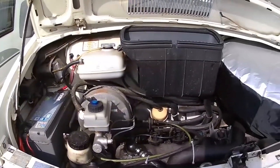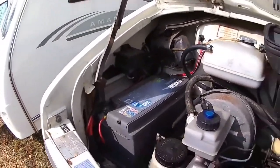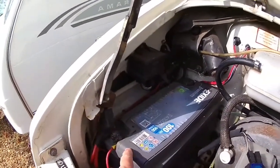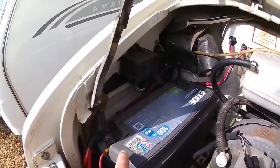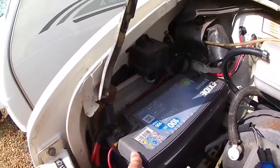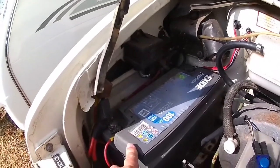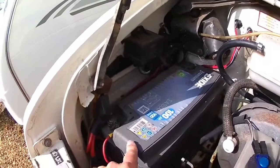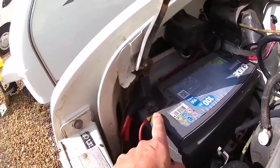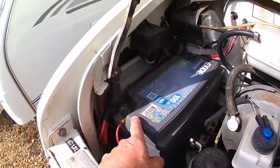The third thing you've got to do if you're going to change the starter motor is disconnect the battery. But before you do that, on modern vans with solar panels you have to check that the battery-to-battery charger is disconnected, because on some modern vans the solar panel charges the start battery as well as the leisure battery. Make sure that's disconnected or switched off before you disconnect the engine battery, otherwise you can cause damage to your solar panel controller.